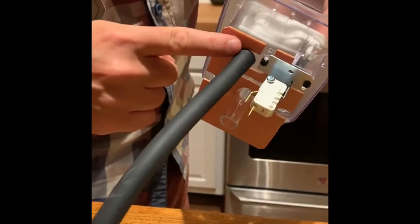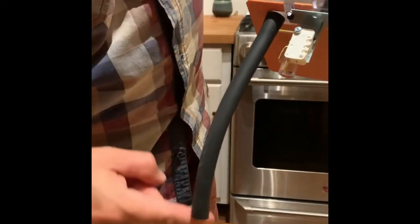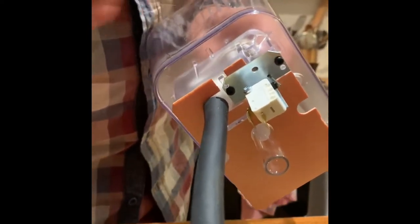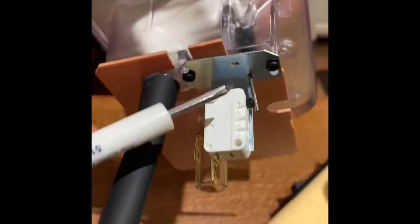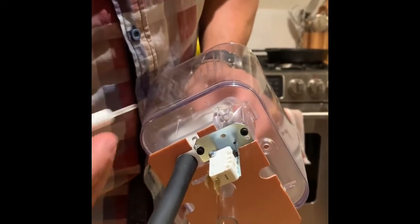This is actually the water intake — water comes down through here and into the heating element, then back up. The floater has a little rubber piece and you can't just pull it off. So we need to take the switch off, remove the rod, and then pull the floater out and replace it.